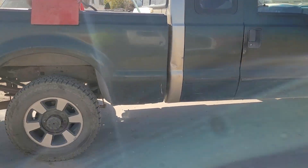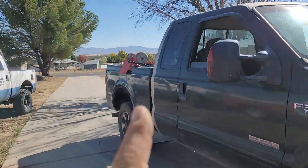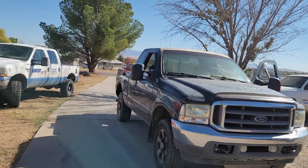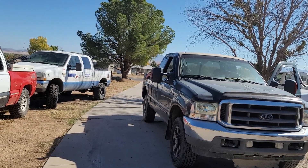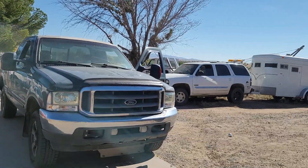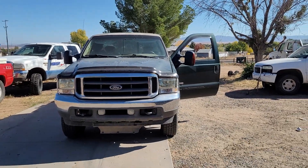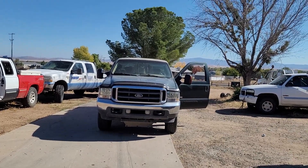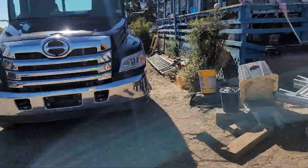That's the basic truck. There's a little bit of carnage from that chase — she gave our officers a run and a half. It has had a tranny issue since the day we got it. But I've got a standard transmission and a manual-shift transfer case, the right vintage to go in here. So that shift-on-the-fly button stuff is going away — I despise it. I do not like turning my four-wheel drive on with a switch; it usually causes headaches.